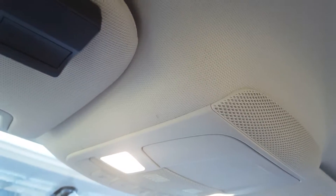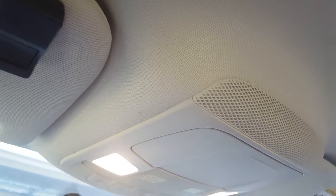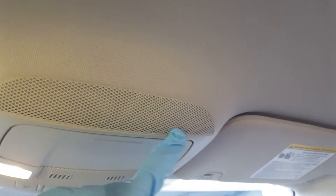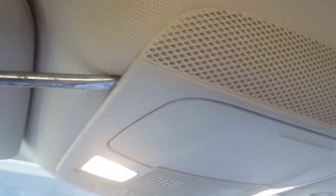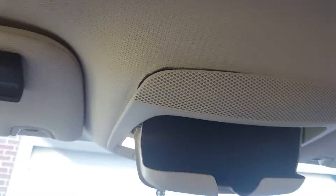What I found best is — you can kind of see little markings here. I started on this side and kind of give it a light firm pull downwards, worked my way over and gave it a light firm pull. You want to be careful because this is plastic and you do not want to break the housing or the clips. I do not recommend pulling on this piece here — all it is is just melted onto it. Just kind of shove your screwdriver through here and give it a light firm pull just like so.